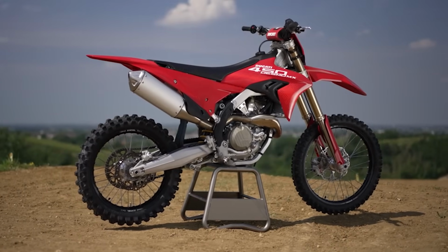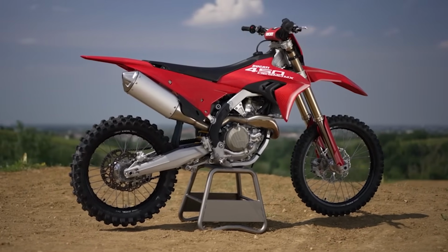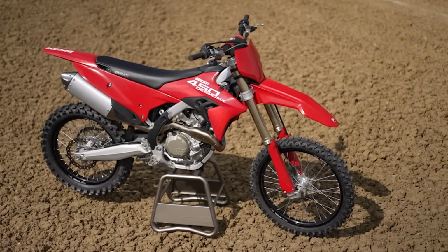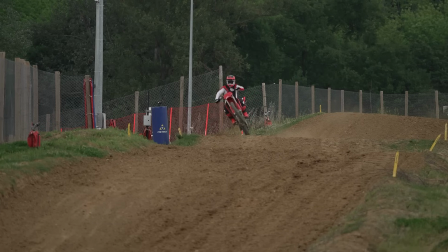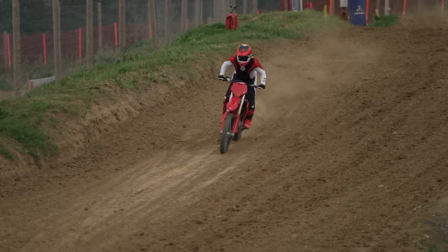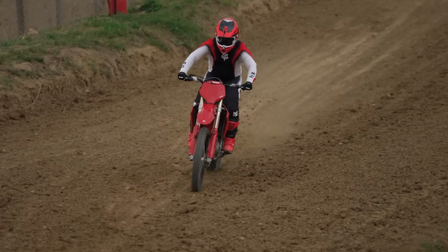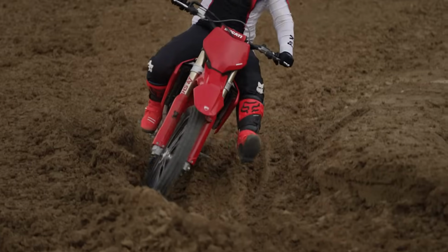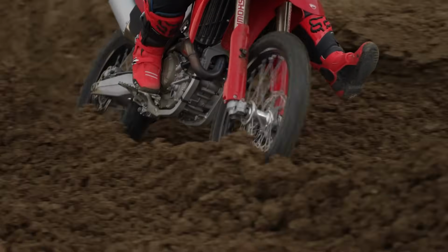It basically falls right in the middle of what's very typical for a 450. At first, when I knew they were going to run the Desmo system, I thought this would be a larger bore, shorter stroke motor, really try to spin it up RPM-wise, but they kind of kept with a very neutral setup there. However, coming into the Desmo system again, it's a very free engine. I would say it is the most 350-like 450 I've ever ridden.